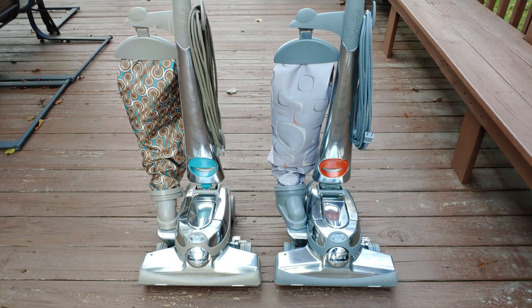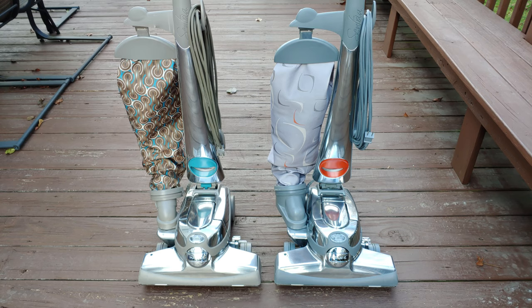So I'm going to do a whole house carpet cleaning with the Centria 2 handling the bulk majority of the carpet on the second floor and the Centria 1 handling all the carpet on the first floor, which is a little bit less. Before I do the whole house carpet cleaning, these two machines have different fill tubes. Therefore, the bags, even if you use the same exact bag or a compatible bag, actually install a little differently on the fill tubes. Let's examine that a little closer.